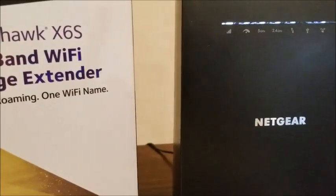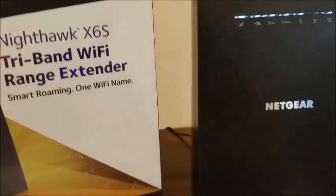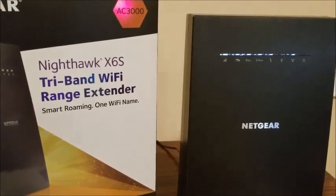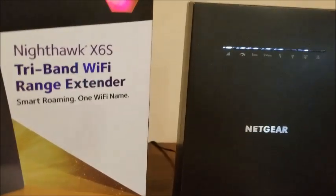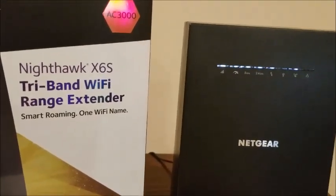Now, once you get this connected and paired up with the WPS, you log into the wireless extender web page to complete the setup. Now, the immediate thing, at least for my extender, is that there was an update for the extender available. The version that I updated to was 1.0098, which is the latest as of today of this review when I initially did the setup. Now, I do recommend that you update, if there is an update available, immediately before doing any of the setup.